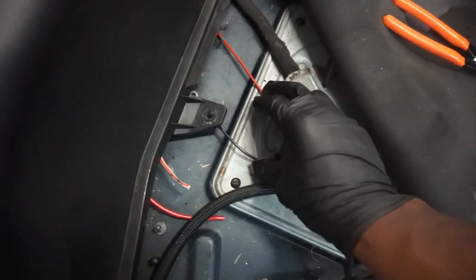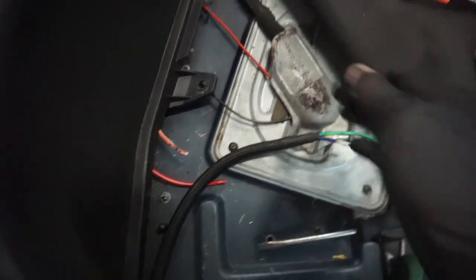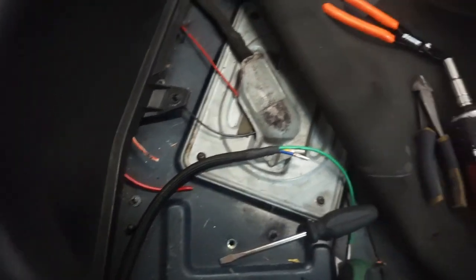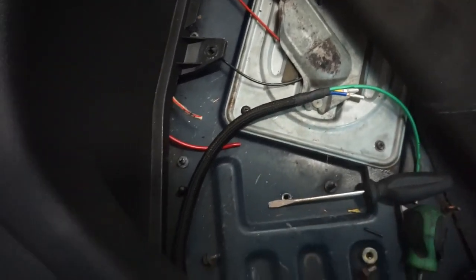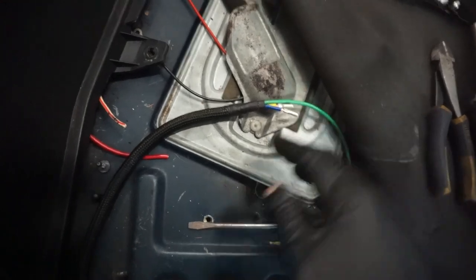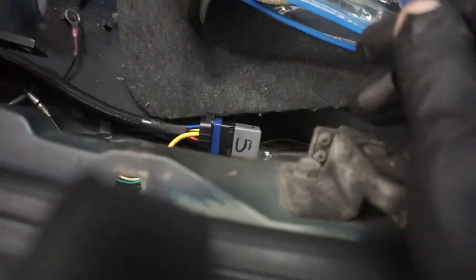So there are no additional things here. Because if we fully commit this, then we have an unbroken wire from the hanger through this into the car, and that's not serviceable. So we need to add a connector in there, which I will do after the fact. I just don't have any right now. And that'll live under all of this. Okay. So now we're gonna strip all these wires back, make all our connections, put on our shrink wrap, melt it down, and this install will basically be complete.